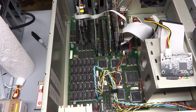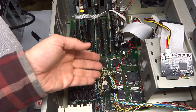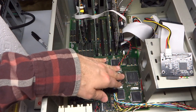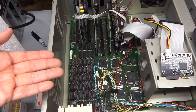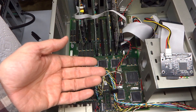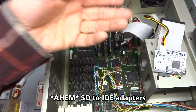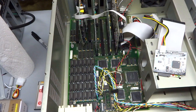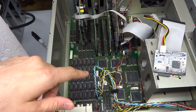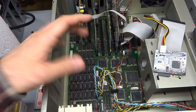So where am I going with this? I thought, what is different about my 286 motherboard from another? The chipset is made by, I think, SunTAC. But because it's a clone, it should work exactly the same as any other 286. And reading around, plenty of people were able to use compact flash to IDE adapters on their old computers without any issue. So what's different about mine? The BIOS. This computer was running an AMI BIOS from around 1987 or 1988 designed for this particular motherboard — a DFI Racer motherboard.